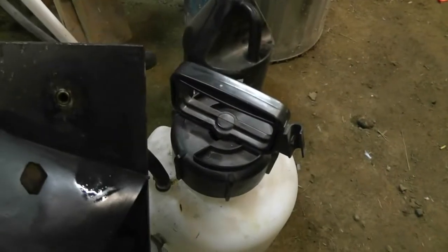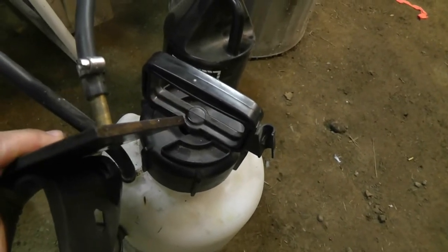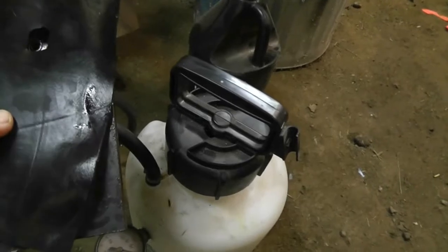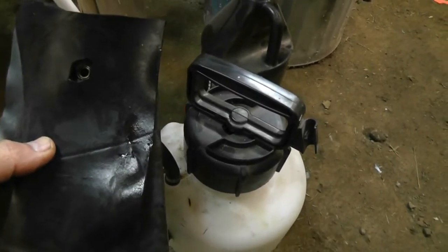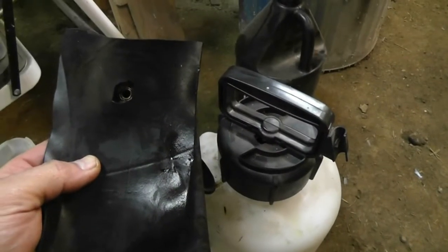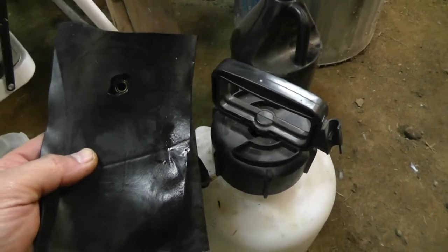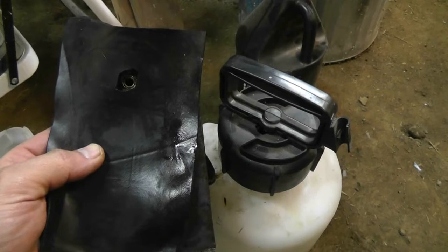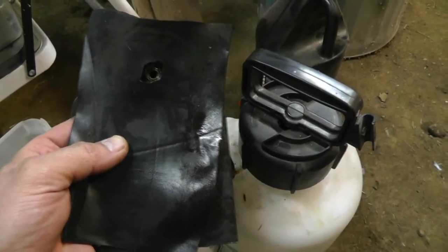I just took the hose, and took a piece of 1/4-inch plate, drilled a hole in it, tapped it, and put just a brass fitting on it, and a bit of old rubber. And I just use that. I put it on top of the master cylinder and pressurize this, and then I just open the bleeders for whichever reservoir is appropriate there. And it works quite well. It blows a lot of the stuff through there fairly fast, so you can go through a fair bit of fluid fairly quickly, but I think it works quite well.